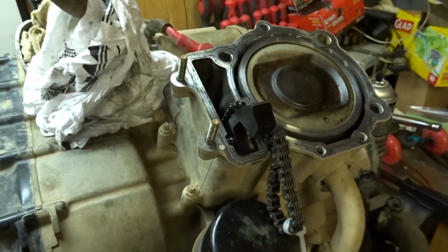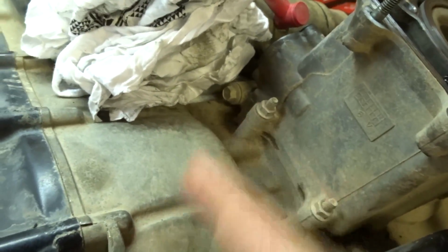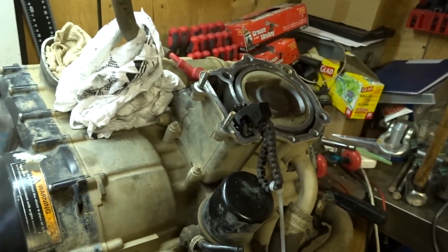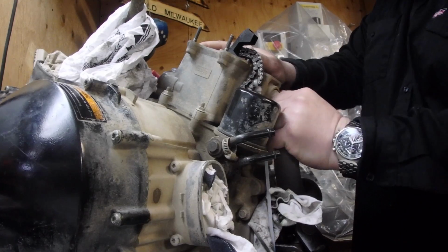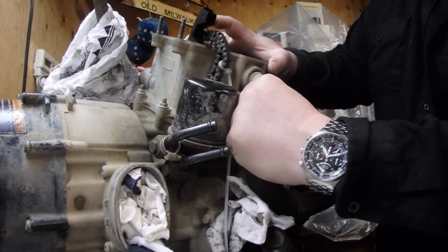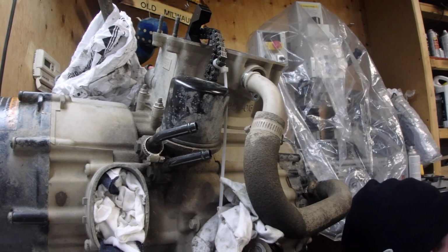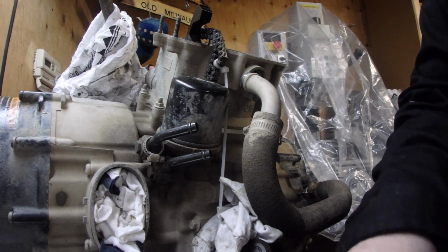So at this part of the game, the only thing we should do to remove the cylinder itself appears to be two bolts right there, and this coolant pipe, which has another beautiful Torx, is going to have to come off, and then that cylinder should just lift right out. Actually, that broke free quite easy. Turn this lightly now. This hose should just wiggle out. There's a better view. Uh-oh, O-ring, O-ring. Definitely want to be careful of that. We'll add that with the rest of our pieces.